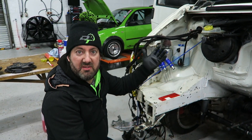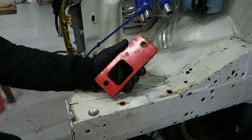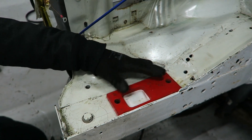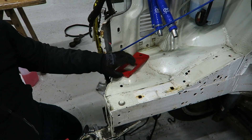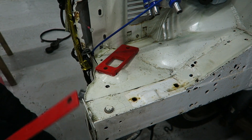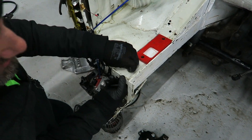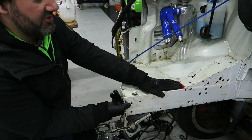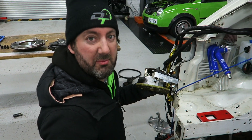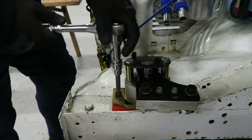You've got your original mounting point here, spot welded in, so you can just drill it out and take out this part and sell it to someone whose one has rusted out. The kit comes with this little spacer to clear the notch on the chassis rail — it also acts as a good template. Pop it down, feel it settle into position, mark your holes through there. Then there's a captive plate — rather than just putting bolts through the top of the chassis rail with nuts underneath, I've devised a captive plate that goes underneath to hold it in with the bolts provided. This is a MK4 mount — mine is a Vibratechnics one from Dark Side Developments, but many people would just use a standard MK4 mount. Pop it on the top, put your bolt through, and wind her up.